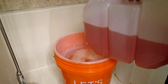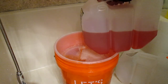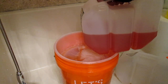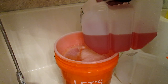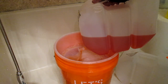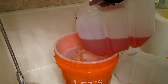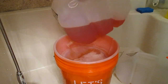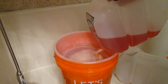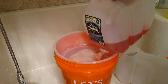I know we could use the cheap stuff, but my dad is always on Dex Cool — he won't use anything else, no glycol alcohol or whatever. I researched a lot about Dex Cool and they say it can actually gum up, although they say GM has changed the formula. It's still kind of gummy in the car — when I flush it out you can see a lot of gummy stuff. I did filter a lot already before this; this second filter is 25 micron so it's really fine.